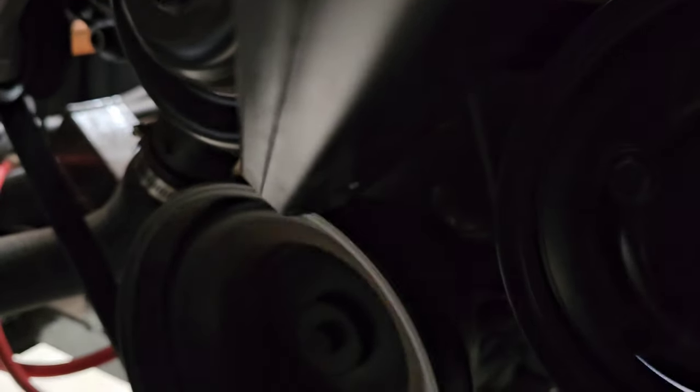Way off. Woo, that fan's blowing. Okay guys, I loosened up the distributor, I turned it, I am now at 8 degrees advance. One other guy that I spoke to has a carbureted system and he too is running at 8 degrees, and he says it's a perfect runner. So I've heard 6, 8, 10, 12.